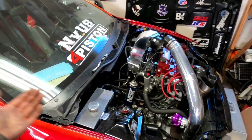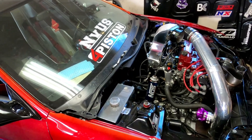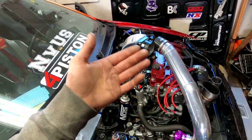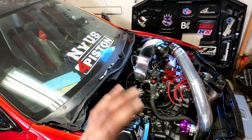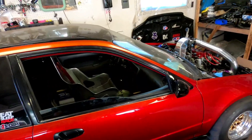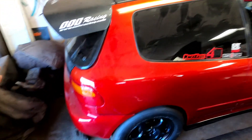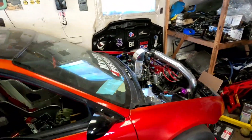Make sure you guys like, subscribe, and share. That's how you service your built motors, or even your regular motors. If you don't want to have any problems, the best thing you do is buy a ten-dollar can of fogging fluid. Now I know the cylinder walls are fine, the valves are fine, the valve seats, guides, everything — piston rings — it's all lubed up and good to go for the winter. It gets really cold here, like minus 35 in the winter sometimes, and I don't have a heater in here — that's why I fog it. With the all-wheel drive kit we're hoping to go a low nine or maybe even do an eight-second pass someday. Don't forget to like, subscribe, and share — I'll see you guys on the next one.